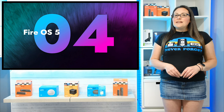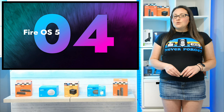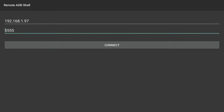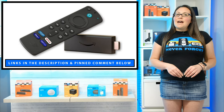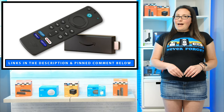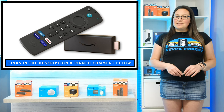If you have a Fire Stick that is running Fire OS 5, you can't add additional system storage to install apps. If you try to add your storage as extra system storage on your Fire OS 5 Fire Stick using ADB shell, you will get this error, connection failed. If you do want to add more storage to install more apps, you will need to upgrade to a newer Fire Stick that supports this.